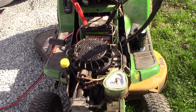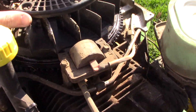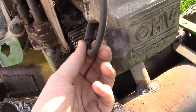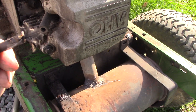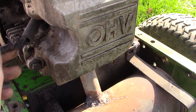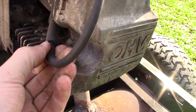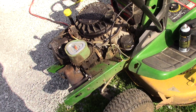Being 2021 right now, we're pushing almost 20 years on this lawnmower — pretty impressive. Here's something that'll really throw you: see the well-worn coil with the pickup magnet here? It's heavily burned from the fires. Here is your plug wire going down to the spark plug — also burned and frayed. If you just reach up here and give this a tug, there's the actual wire that goes through the boot to your spark plug: completely burnt and frayed. What we do is just ignore that and shove it right back into the boot as if nothing happened.